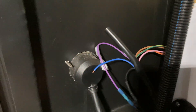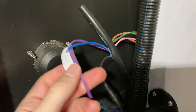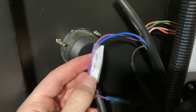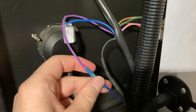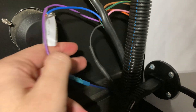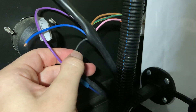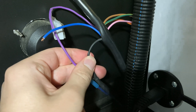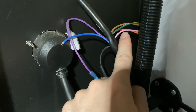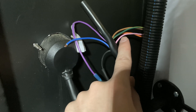We're back with the factory wiring harness in the back of the Alucab camper. This part covers the modification I made to the third tail light. The purple wire, as installed by my installers, is still connected to the blue positive going into my passenger side tail light. The black wire is new - it used to be connected to the common negative for the camper, which is the pink wire, but it's now connected to black. So the pink wire, which still has the negative for my lights, USB ports, and cigarette plugs, is now isolated so it's only camper-related negative on that wire.